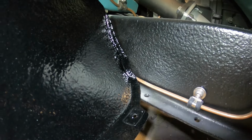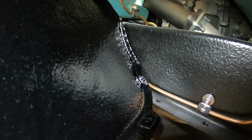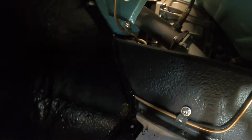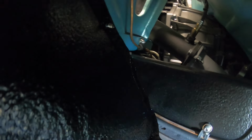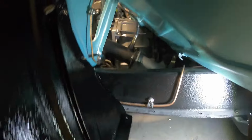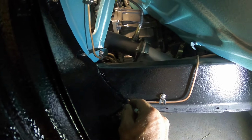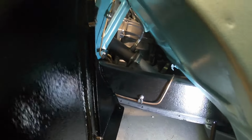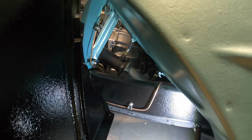See the old brake lines running down low, and this piece here is gonna rub on it, which I don't want. So I can reshape that brake line up into that little divot there, or I can bend back that return just a touch. I should stop waving the light around so you can see what I'm on about. So I could just bend that up a little bit, or reshape that brake line. Either. Maybe a bit of both, but then the brake line won't look straight-ish.